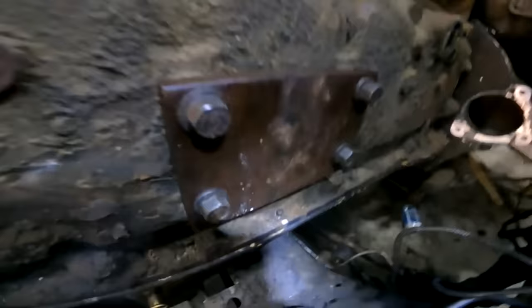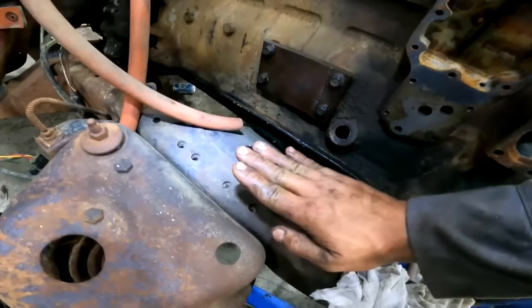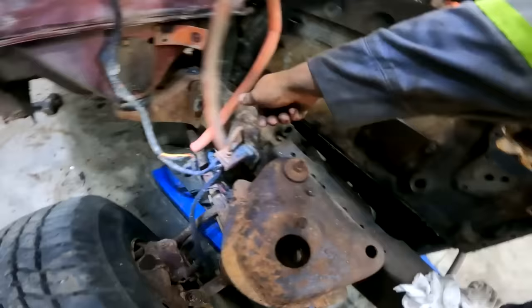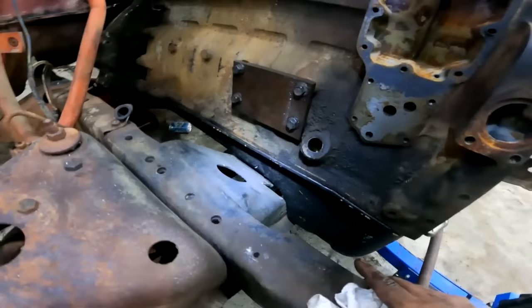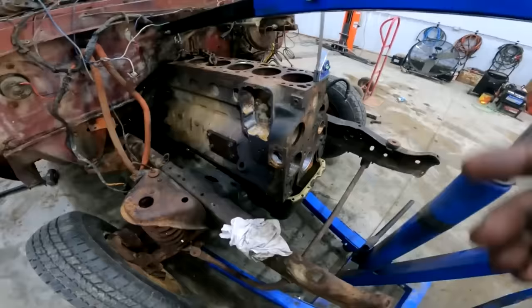Alrighty, look at that plate bolted on the side. It's almost straight. I mean, a couple thou, never hurt nobody. Now all we gotta do is come out the basement here. Basically 90 out of here, so she can sit on here nice and flat. Well, this is the hockey puck or whatever the bushing I'm gonna use is gonna take up her side to side. And then weld her solid here with a 45. Same thing on the other side, and the magic of camera work.